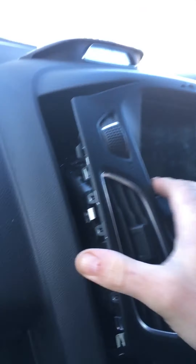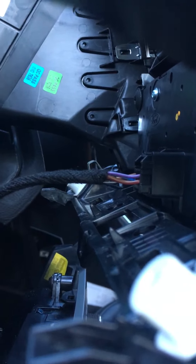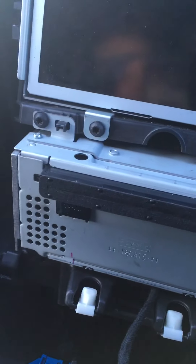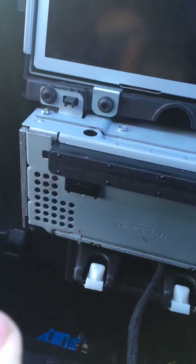Once that's forward - it's really difficult with only one hand, but I'm just trying to help you out here because it was a pain. There's one plug on the back of it in there. Pop that plug off and then you can access everything in there. The CD player, which is actually the audio control module, is held on by two T25 Torx bits and the screen is held on by two more.